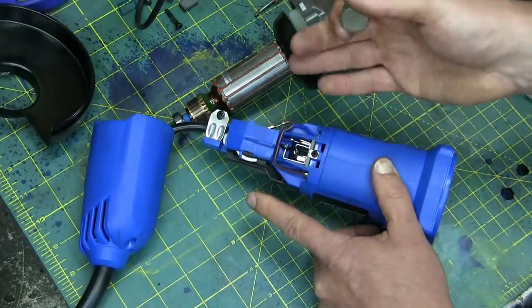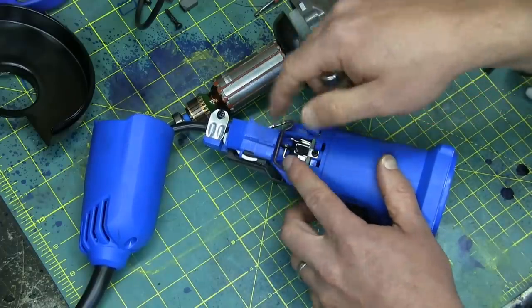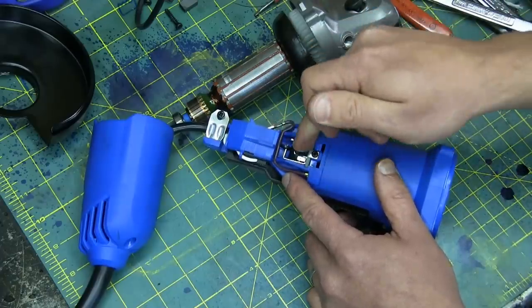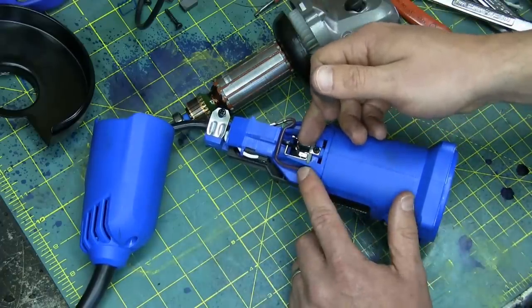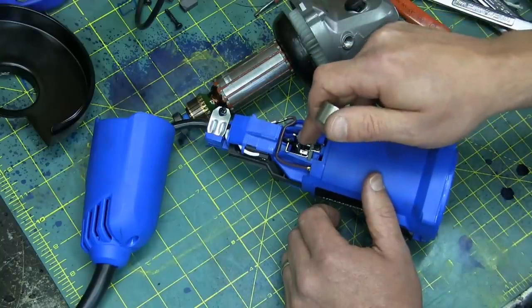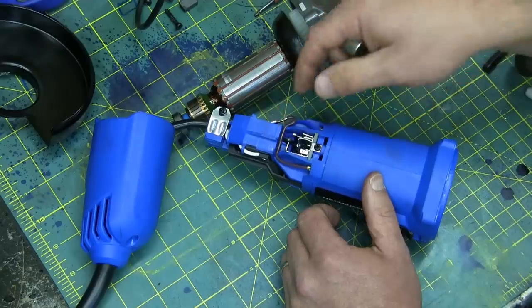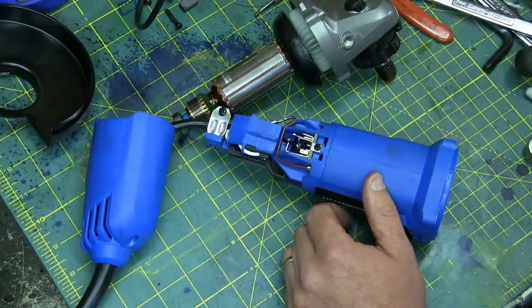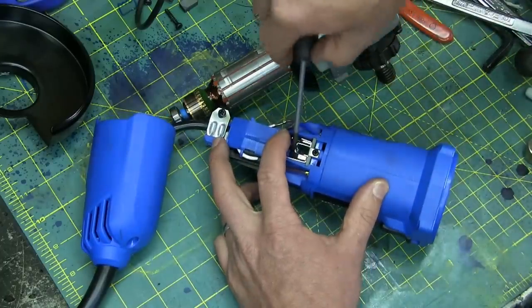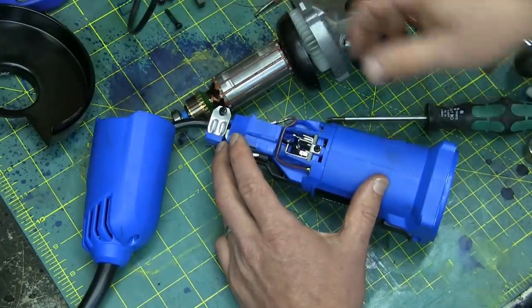While we're on the subject of brush holders — at least they're metal, I'll give them that. But they're just steel flat plate, bent all to hell, then electroplated with zinc. Really not the best, because steel has terrible thermal properties — steel does not transfer heat nearly as well as brass or copper. That's pretty crappy. The brush spring here is actually fairly sturdy, good contact, a fair preload — it's just a watch spring that forces the brush up against the commutator bars.